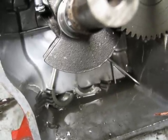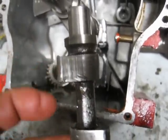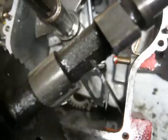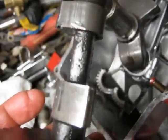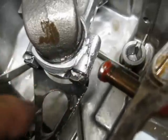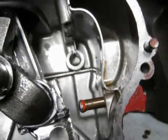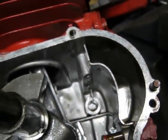At least it didn't come out the side of the block — that was a good thing. Now you can see some damage here on the intake camshaft lobe — a gouge on the side here. It also wore off the top of the lobe, so I'm assuming the counterweight on the crankshaft did that. It gouges there in the middle. Some damage on the exhaust lobe there too, but nothing like the intake. I can probably fix that on the camshaft. But the connecting rod did some damage as well — the lock tab and the side there gouged it up good. I may be able to reuse it, I'm not sure. I don't think it damaged the block other than that little thing we noticed on the paint. A little JB Weld could cure a tiny hole.